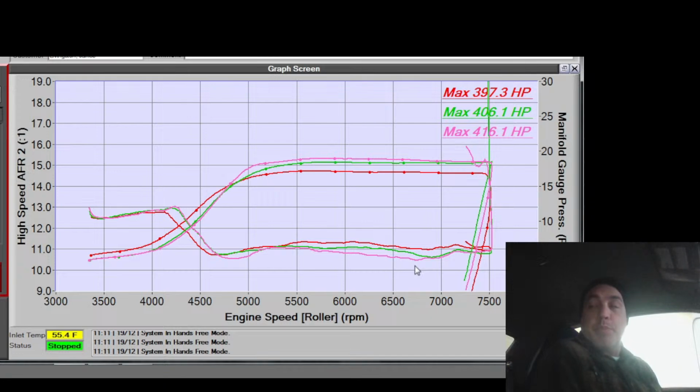Ooh, I hear the pump went from high to low speed there, and I saw the air fuels change by about 6%. So this regulator is not liking it very much. Now what that also means, though, is that my fuel pressure differential compensation is not working correctly. Does that even work on this? I don't know. No, this doesn't have that. Never mind. I keep forgetting.